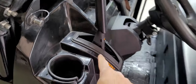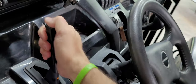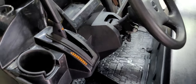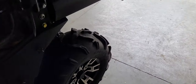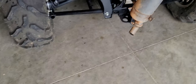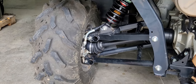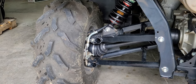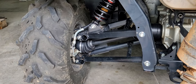The reason why you don't hog it back is that all you're doing is stretching the cable in between here and your two wheels back there. Just adjust it and bam, there you go. When I started, this sucker pulled all the way back and bottomed it out and barely even held. And that, ladies and gentlemen, is how easy it is to adjust the brakes on a Kawasaki Mule Pro F-Series and D-Series.